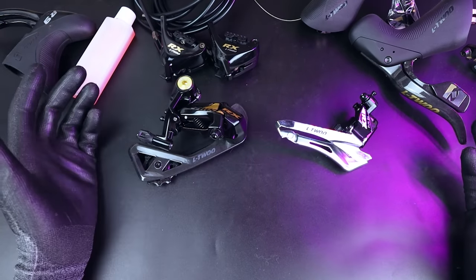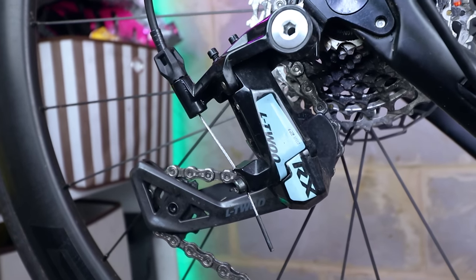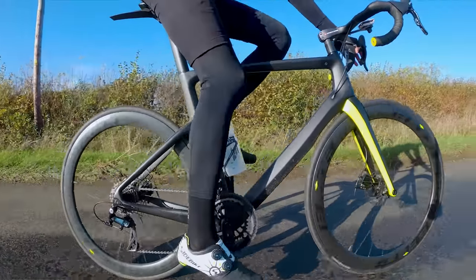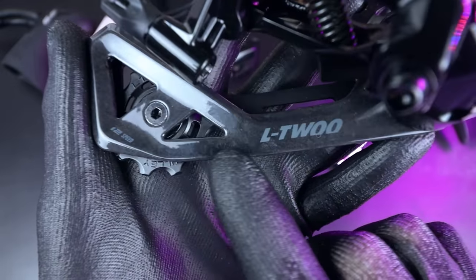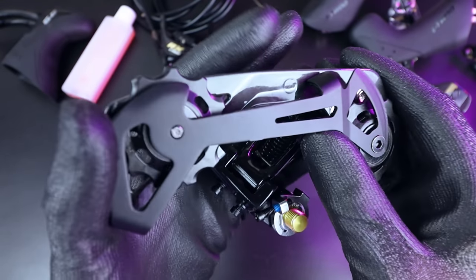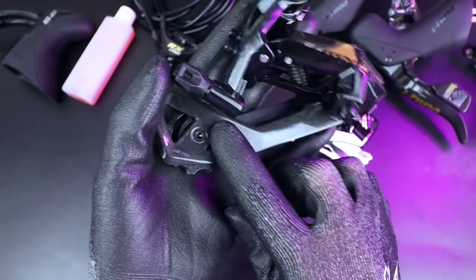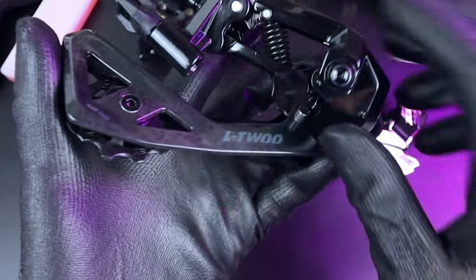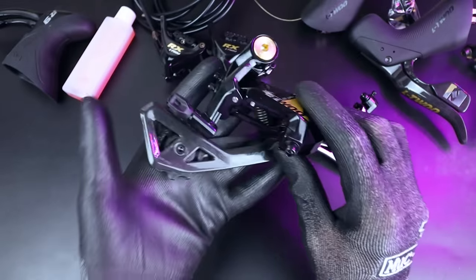Front and rear derailleur here. The rear derailleur is exactly the same as the one I'm currently running on my other bike, apart from some gold decals versus completely silver. The quality and construction seem really, really good. Part of the derailleur cage is made of carbon. And I noticed there's a little grub screw — normally on lower-end groupsets the rear derailleur cage is pinned in place and you can't remove it, so you need to replace the whole thing if it breaks. Whereas on this one you could just replace the cage, or potentially swap it out for one with oversized pulley wheels.